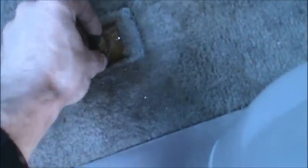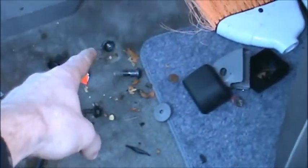As you can see, I didn't even really move the bolts out of here. On this specific Ford, there's just half inch bolts that just sit right in here. Unthread them and yank them out. There's 4 of them. There's 1, 2, 3, and 4. And then that bolt back there is your seat belt. So I took all 4 of those free.